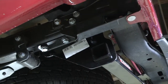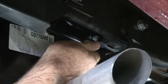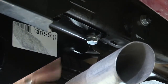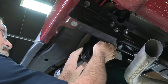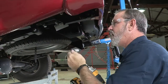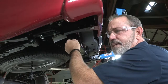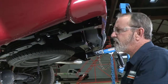We'll go ahead and do the passenger side as well. Our last step is going to be to snug the bolts up into the frame and then torque them down. Before I do that, I noticed this bolt here is having a hard time going in — it's getting tight as I'm screwing it in. So to be safe, I'm going to take the bolt out, take the hitch down, and inspect the weld nut and clean it if necessary.